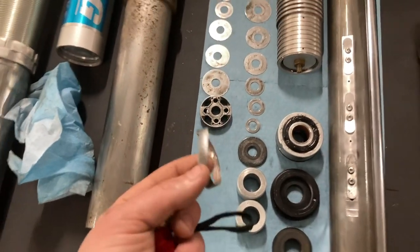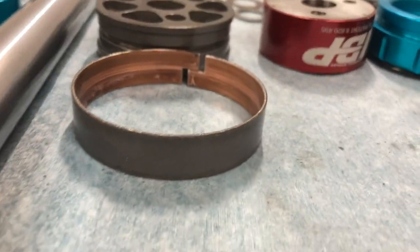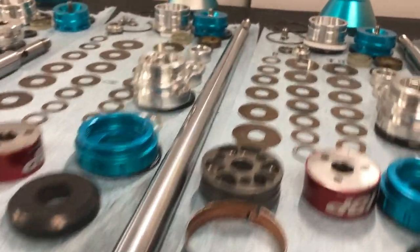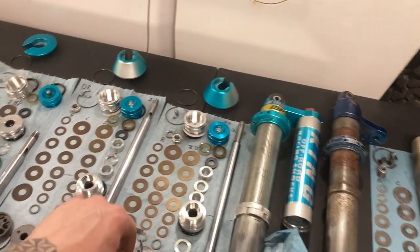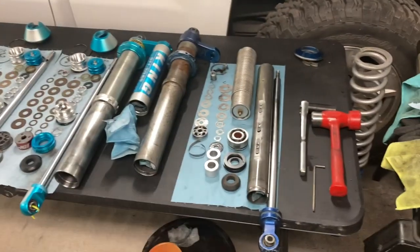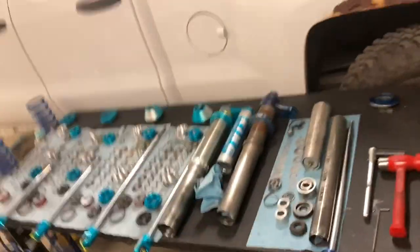The bronze wear bands - same thing on both, they have bronze wear bands. That's what they look like when you bring your shocks in on time. The oil in these was quite dirty, the seals were blown out, and there was leaking on one of the shafts pretty bad. Definitely want to bring them in sooner than this. I pretty much have to rebuild my shocks three times a season - last year I only did it twice and this is what happened.